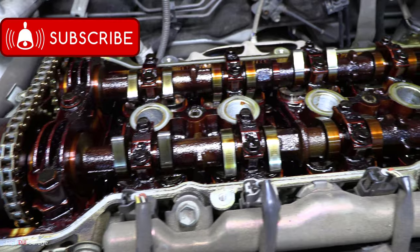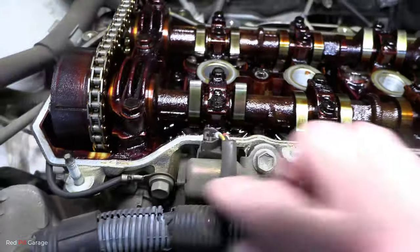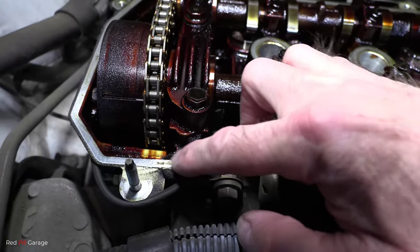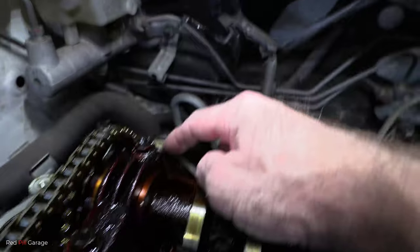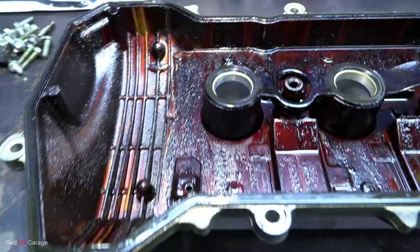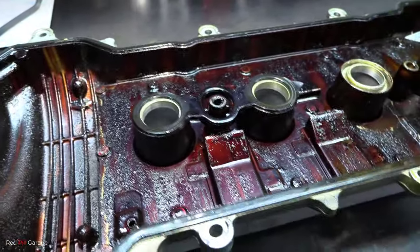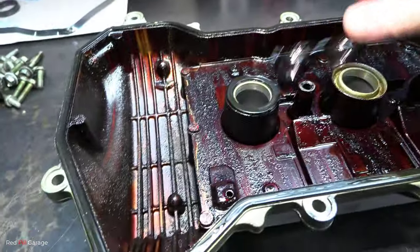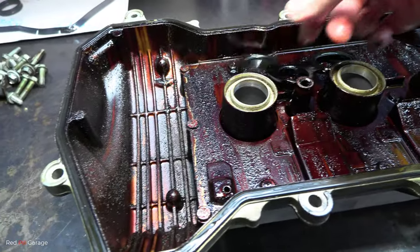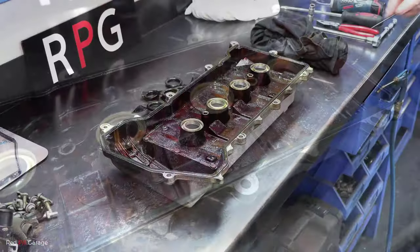Taking a closer look, you can see the old glue residue where the timing chain cover meets the cylinder head. Once we clean that up, we'll apply new gasket glue to seal that joint. Here's the old rubber gasket — it's pretty stiff and shouldn't break like that. Rubber should be nice and soft, but once the gasket becomes old it goes hard and brittle and just breaks away easily. That's why it can't seal anymore and that's how you get engine oil leaks.